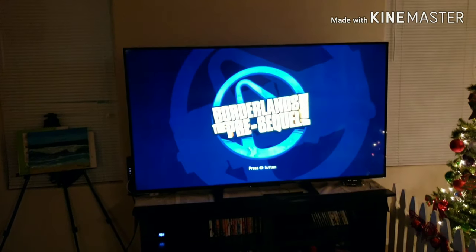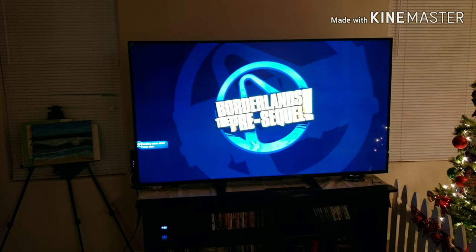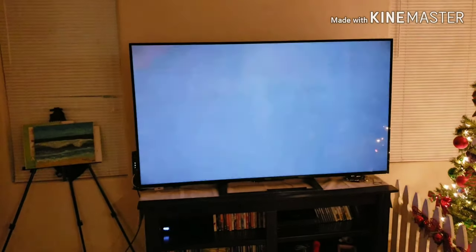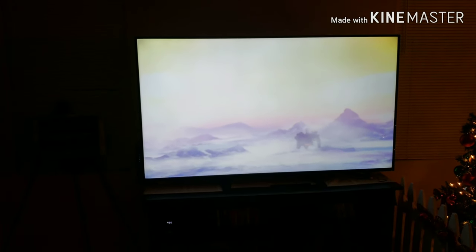So there you guys have it. I'm just waiting for it to load and see if, yep. Guys, that's what the issue was. It wasn't sufficient thermal paste and it was dry. So definitely replacing that with some new stuff will fix your problems, guys.